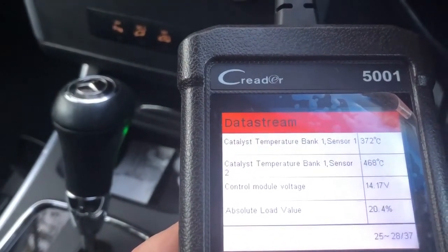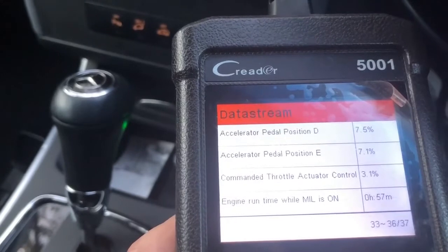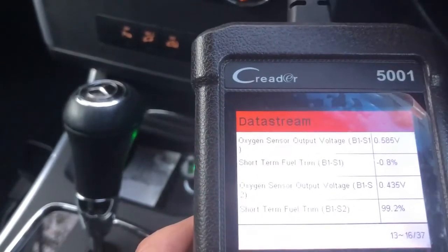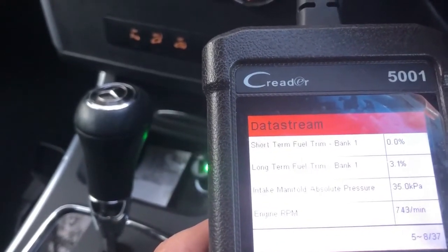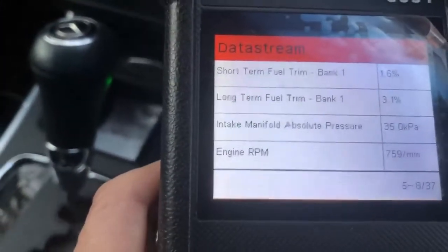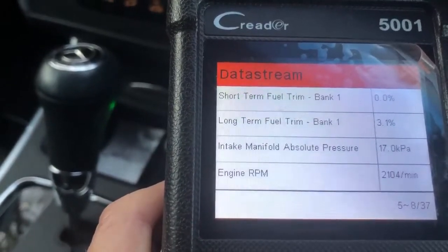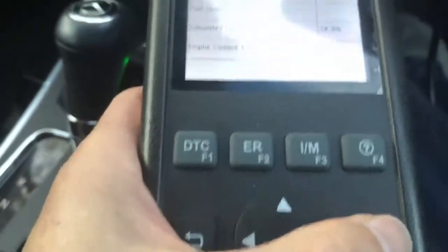So it might be that at the moment it's a little bit intermittent, the fault, and I can't really see an airflow meter sensor here. Maybe what I'm going to do is remove the manifold absolute pressure sensor and give it a clean. Sometimes it just needs some cleaning. And then see how we get on, because the engine light has gone out. So the ECU must have calculated that the readings are okay and it's taken the light out.